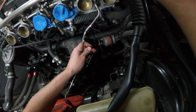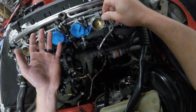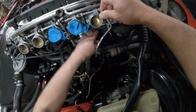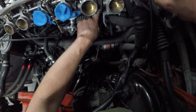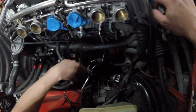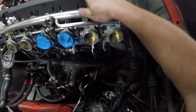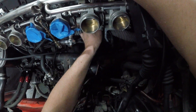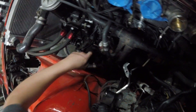We're gonna see what we can do to get it into place. We have pictures of what we're supposed to be doing, what it's supposed to look like. This tube has been manipulated a lot just to get it into the fuel rail and to clear the throttles. Currently it's sitting touching the starter, so now that we have it secured in the fuel rail we know that it clears that.